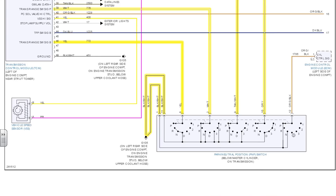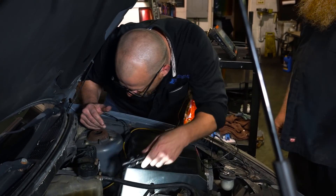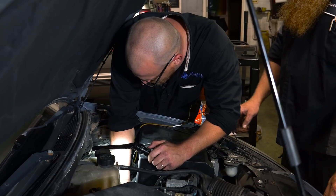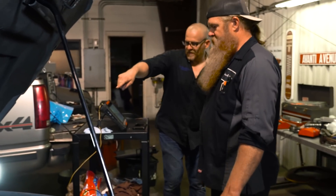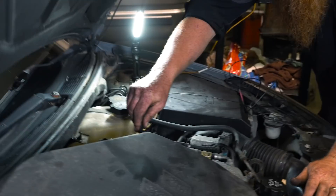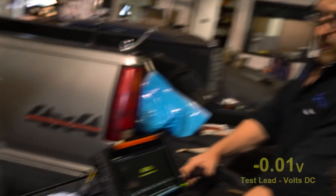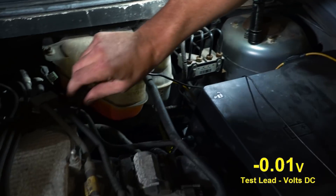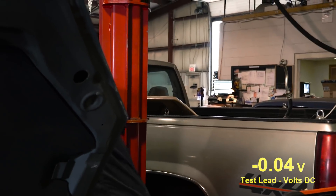In the diagram it shows the ground pin as black and white. It's a black-white wire — it kind of runs underneath. We need to connect the ground up. That's my voltage on that circuit right now. Key is on — let's make sure we have a good ground.